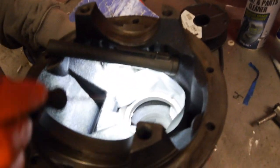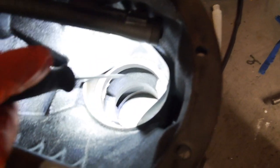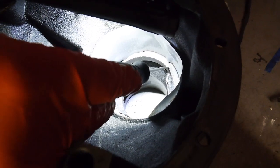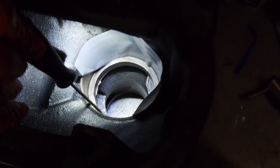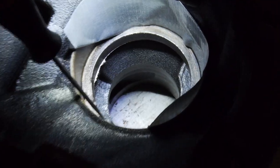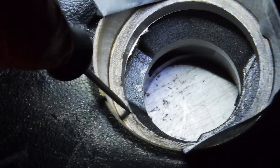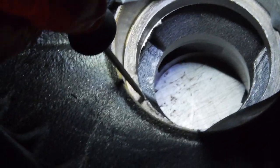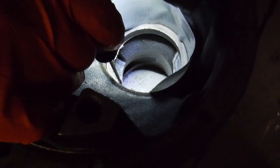So you have to check the bearing seats really carefully, because when you just punch the bearings out, it's really easy to deform the soft casing. So you can see over here I've already started deburring all the burrs, because what happens is you get high spots like that, and that's a really bad burr sitting there. Another one there. So they're just little burrs that sit up, and it's a good half mil. Same thing, when you press the bearing seat down into it, it's gonna sit on top of this burr.